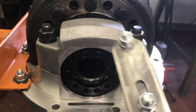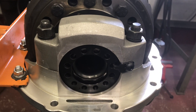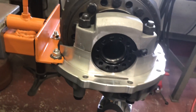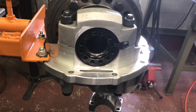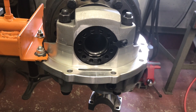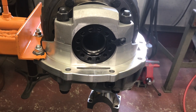The through bolts: the short bolt behind the pinion torques right up no problem. The long ones that go all the way through the case — after about 65 ft-lbs they start tightening like guitar strings. The listed torque is 75, but use your head — you could probably break the bolt if you wanted to. I got these to 75 in increments and we made it.